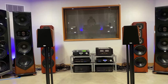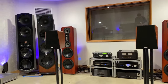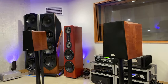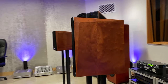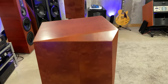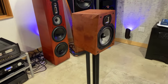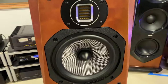Studio HD can be powered by one stereo amplifier, or you may remove the jumper bars and bi-amp. The speaker can be placed in the room or next to a wall thanks to two trim switches — one for treble, which allows you to attenuate the tweeter output by 2 dB to tame harsh recordings in rooms, and a bass trim switch that trims the output by 2 dB, useful for rooms with bass boom.